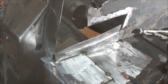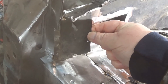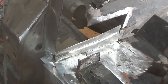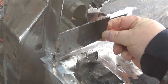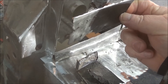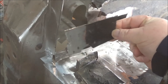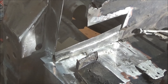This guy here has got to go somewhere like this — it's got a flange on it that comes out to the side, so we've got to build that and make a new panel. Then this other guy fits in something like this. We're going to try to make one big patch template to fill up this area. It might be a little difficult because of this flange work, but at the very least we'll close this bottom section in and work upwards — it might be a two-part patch.